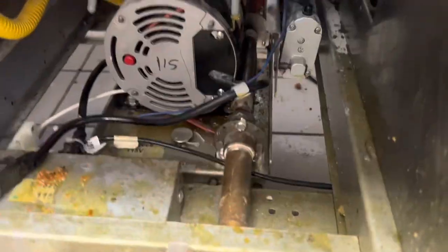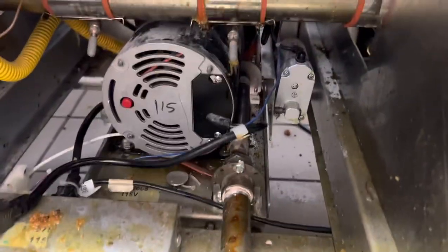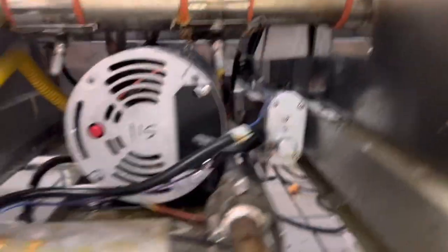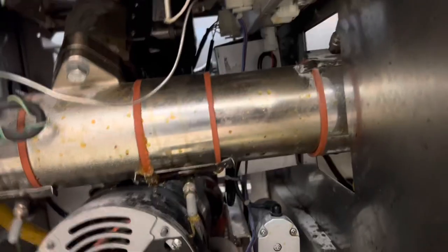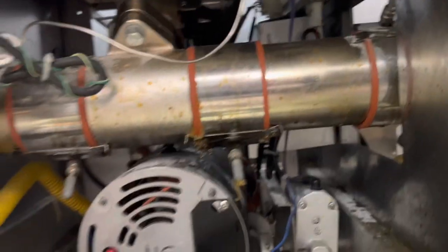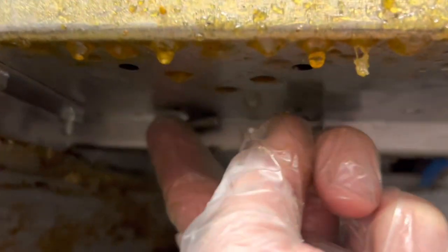In order to drop this motor, you have to unscrew this from here, which I already broke loose and started. Then you have to remove the lower three-way valve that's connected on the inlet side with a wrench. Drop this bolt — these are the only pins holding it in — and then this whole plate will drop down with the motor on it and everything.